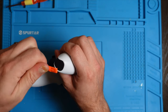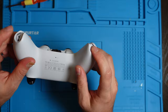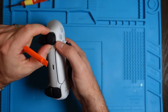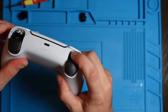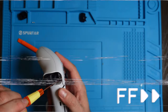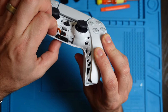So let's take this trim off. We have two screws here. We can also take off these triggers on top, and that's going to expose two more screws. We have these two little tabs here we want to pull out, and this will help us to peel the controller apart.